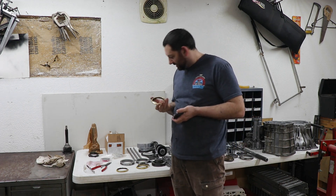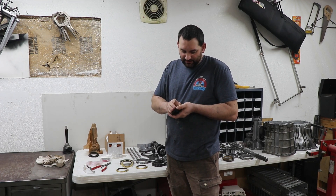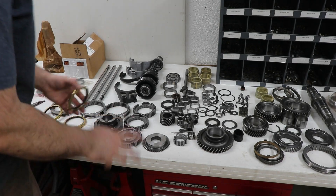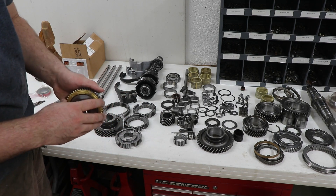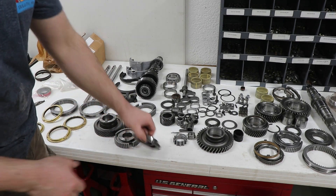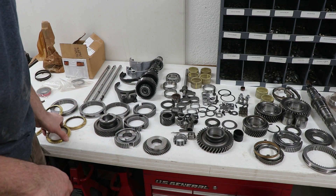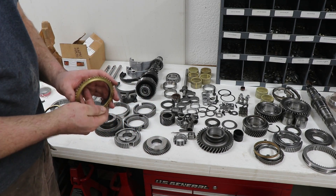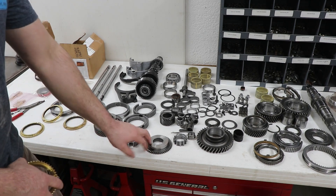This one I can spin a little bit easier, but it's still not bad. I usually chuck these things as soon as they're bad and keep anything around that's actually decent. It is worth noting that if you're checking individual gears, I do suggest checking them against whichever gear surface they are mated to, so that you can check against any various possible differences in machining. These surfaces are not really a wear surface even though they contact - they are the friction surface. They are so much harder than the actual friction material of the synchro, so the synchros always wear out before the steel surface of the gear will.